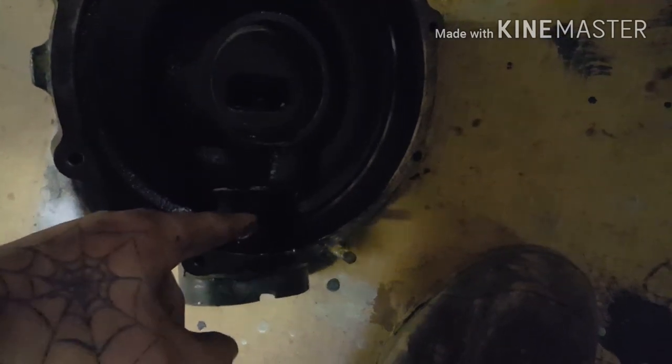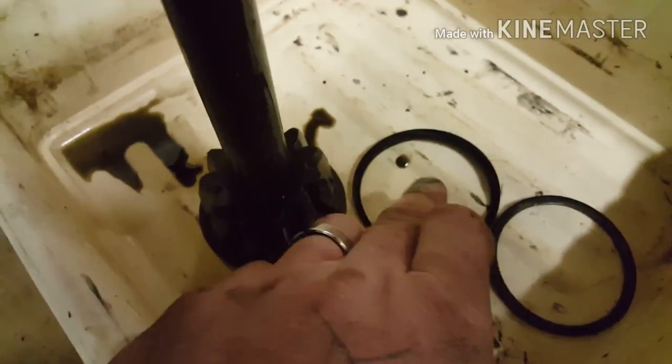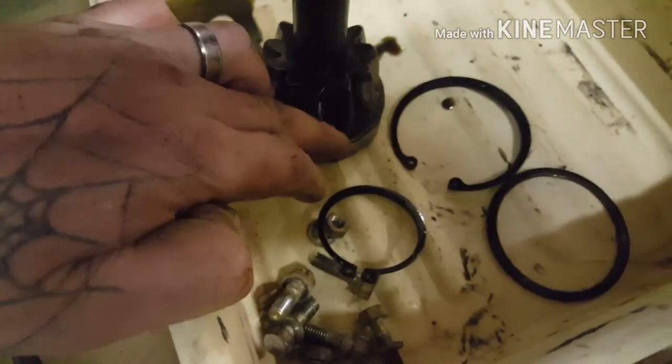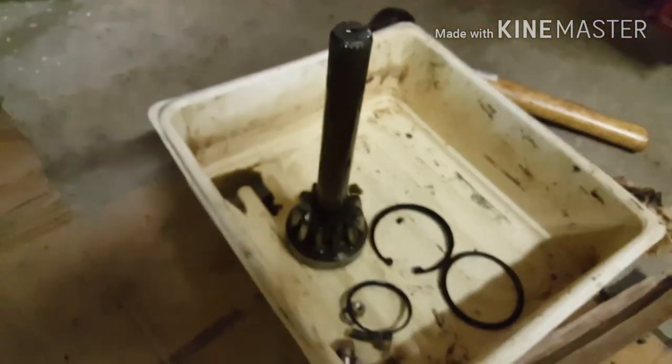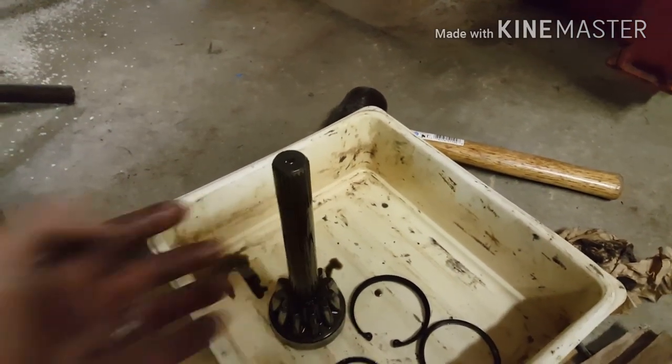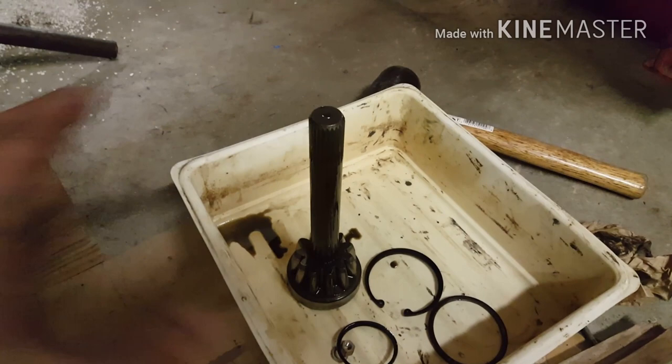To get this piece out, take a punch and punch that gear piece right there, because the bearing is on the other side. Once you remove that C-clip, you can punch the gear — or the edge of that bearing if you can get it — but I'd say just punch the gear, that's what we did. Do it really carefully and it should come out. Take your time, and once it pops out and slides out, make sure you're holding it at the bottom.